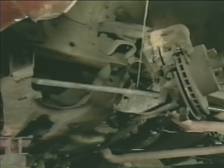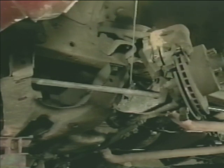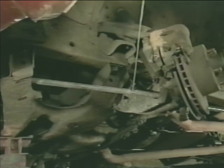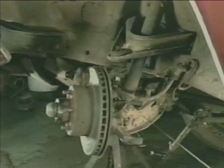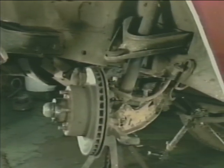The Chrysler torsion bar suspension varies in many ways from the double A-arm suspension we've just been working on. One of the obvious differences is the construction of the lower control arm, which actually consists of 2 major components, that being the actual lower control arm and the strut rod that reinforces it and helps maintain its location in the vehicle. Looking at the lower control arm from the rear of the vehicle, we'll notice another major difference in this type of suspension, the torsion bar.